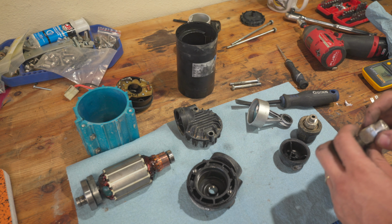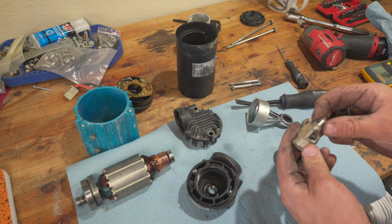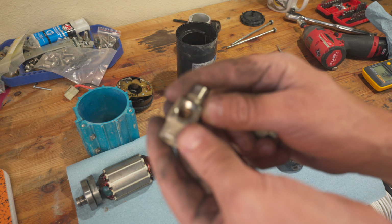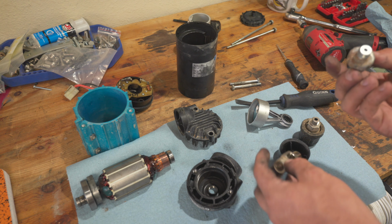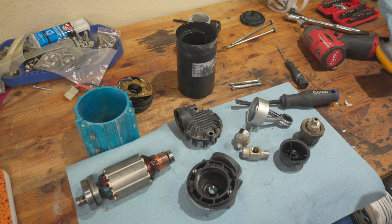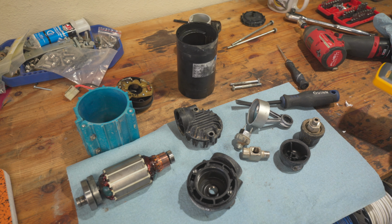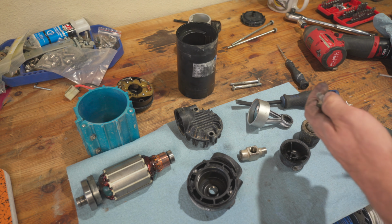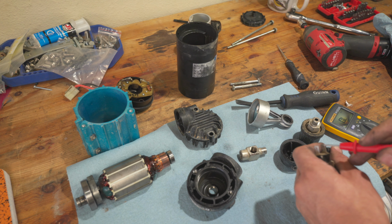We got it all apart, and one thing that I noticed is that all these joints I did not tape, so I will be doing that. Also, there's a clue in there, a little bit of moisture inside these pieces, so I wonder if the moisture destroyed the pressure switch, or if it's just on its way out, because it does not look super great. Now, I have no idea what these pressure switches are supposed to ohm out at, or even if you can, but while we're here, we'll do it, and then I'll see if I can find another one. And then we'll look at putting it back together. But if you guys know, please hit the comments, because I don't know anything about this.